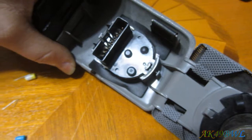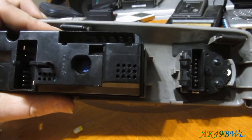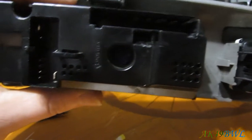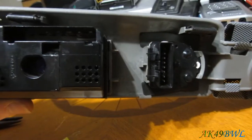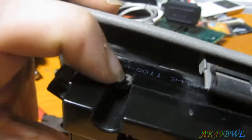And unfortunately, if I want to put LEDs in this whole thing, I am going to have no choice but to get into the wiring harness for it, cut the wire that goes to the interior lighting, and put resistors in series with the wiring instead of internal to the switch, because of the way these things are designed and the fact that there's no way to put a resistor on these things.